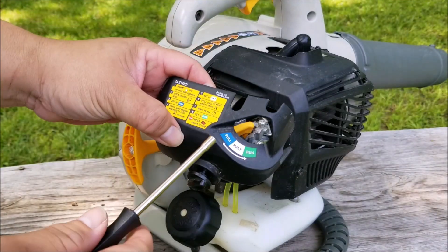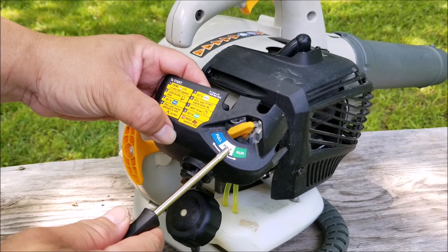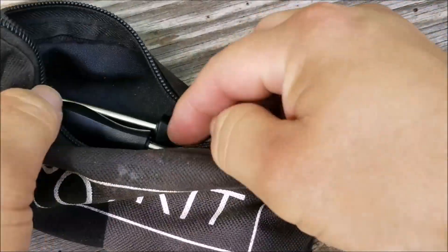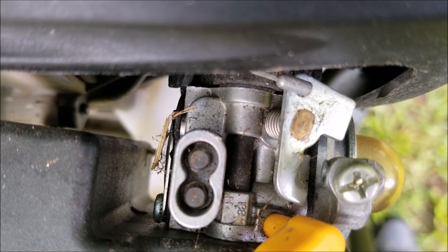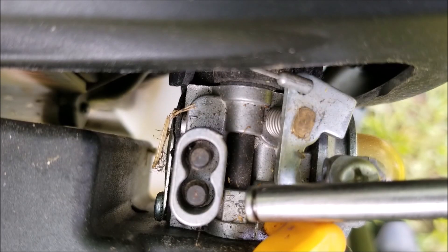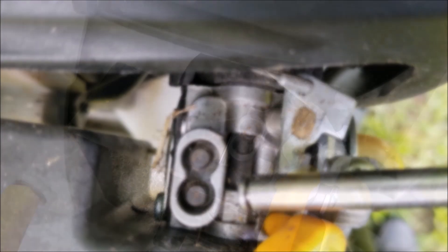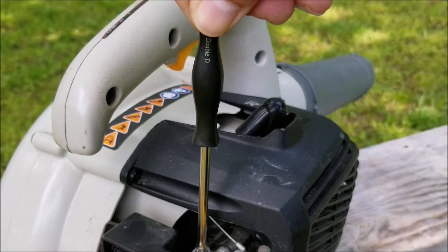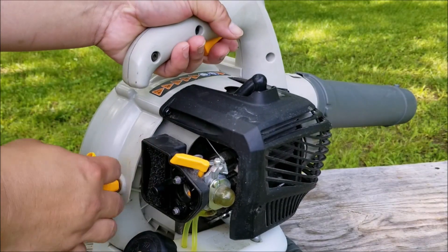It's starting like it's supposed to — in full choke and running in the half choke position — but it's still dying, so it will need carburetor adjustment so it at least idles. If you don't have any carburetor adjusting tools, these are very affordable online and come with several different types. This one requires the double D tool, but yours may be different. On the carburetor there's a letter L near the adjusting screw — this is for adjustments at idle speed. The H screw is for high engine speed adjustment. To start off, I'll turn the L screw a quarter turn counterclockwise to see if it doesn't die. The throttle will be fully squeezed, so if it stays running I might have to start adjusting the H screw as well.